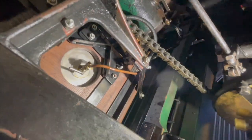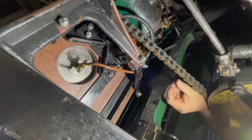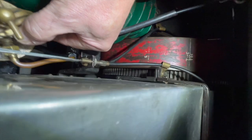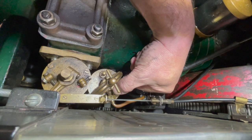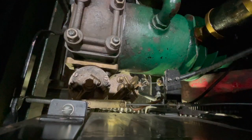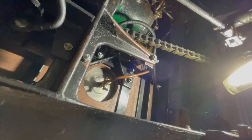That's full of petrol — I'm going to go underneath, turn the petrol on, and hopefully we've got no drips. There's the petrol on. I'll probably go up and tickle the carburettor. This cable here goes to the front of the car and basically it just pushes the float down, which opens the valve in the top here, lets the petrol in. Nothing there, nothing there — that's good.